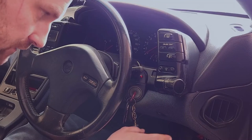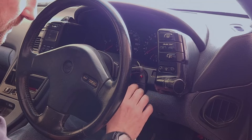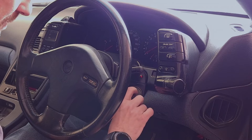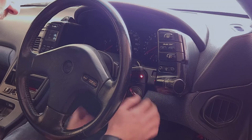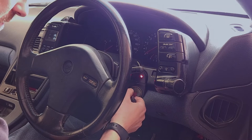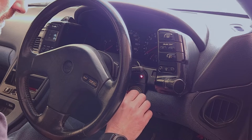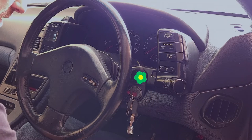Okay. So entering the code that we got off the box earlier — a five-digit code, zero being 10 — what we need to do is we'll see that the LED is flashing, and that means that the immobilizer is still armed. When we turn the key on, it'll go solid, which also tells us it's armed and you can't start the car. Nothing on the dash works. What we need to do to enter the code: we need to turn it on, turn it off and count the flashes. That's the first digit in your code. Turn it on, turn it off and count the flashes for the second digit in the code, and so on.